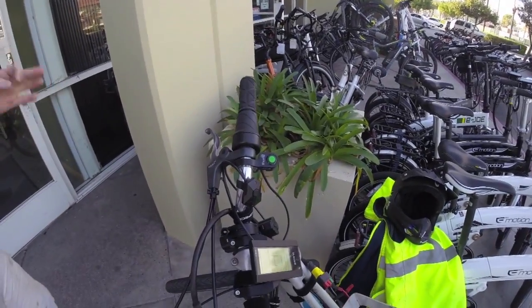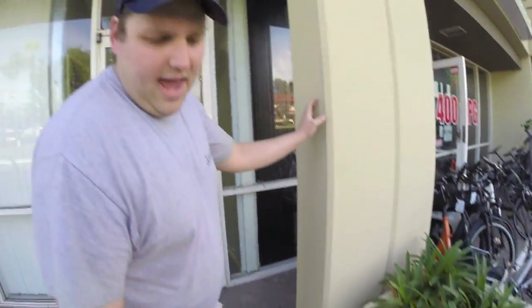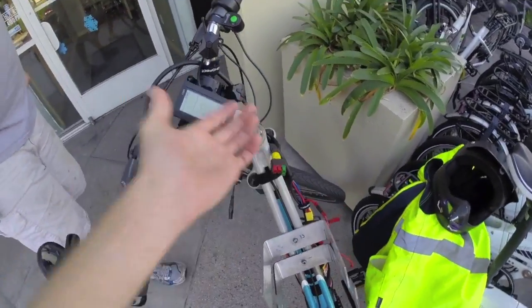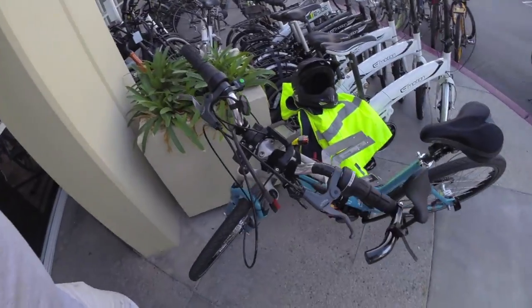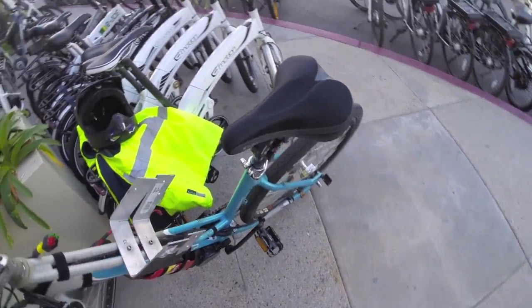What is this? That's part of the kit — when you have motor power and you press that, it cuts out the motor power so you can shift without being under full power of the motor. That's cool — it's an add-on to the kit that I got from Paul at EM3EV. Anderson connectors are definitely the way to go, handling up to 45 amps.